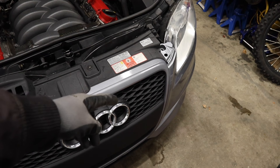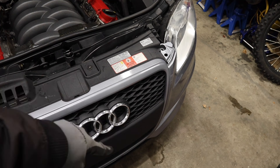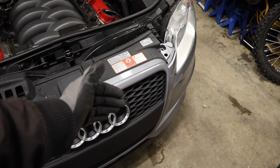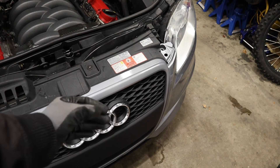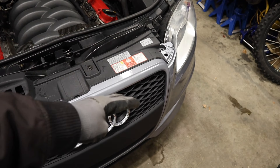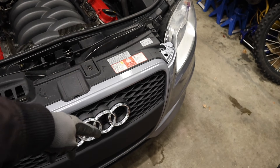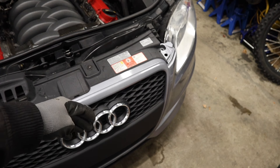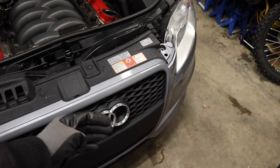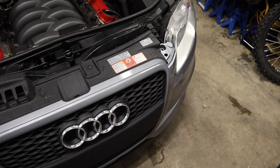The car's back together now, but there's a hard oil cooler line that was touching a power steering bracket. I came to slide those bolts on the adjustment out and it ended up not wanting to budge, so I didn't damage anything else — it was barely touching. Before you come to loosen those adjustment bolts, realize they may be connected at hard points on both sides and you really need to look into it before pulling stuff in and out. It was so minor I just left it and put the car back together.